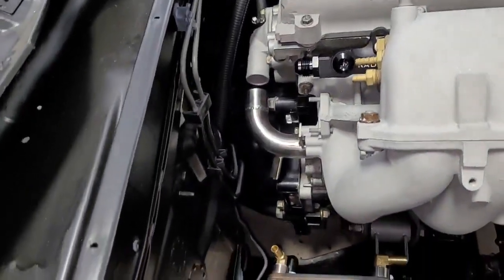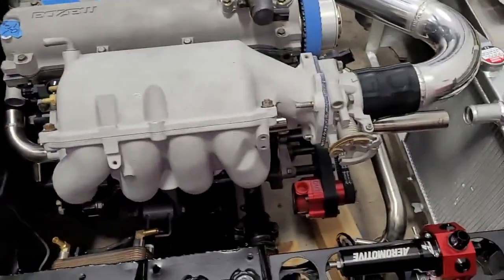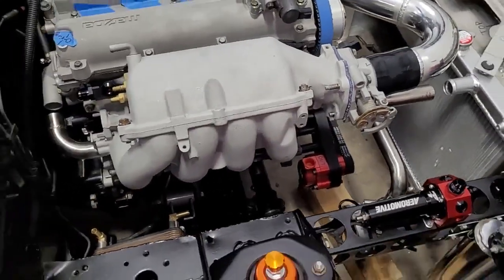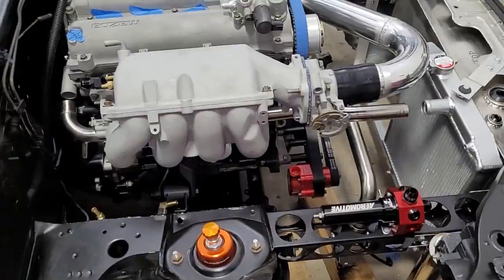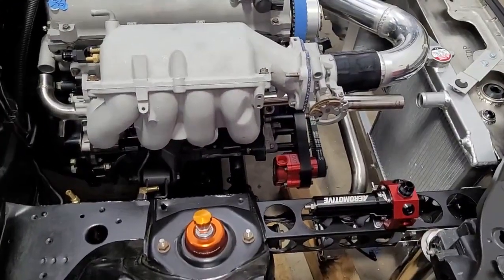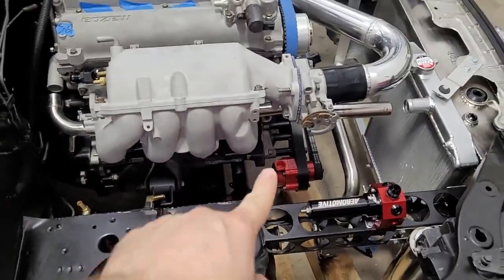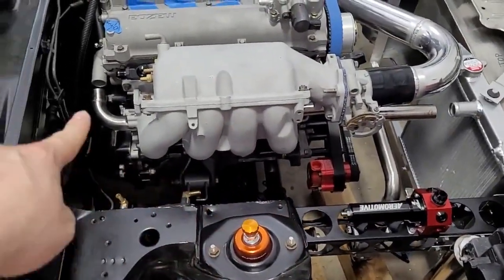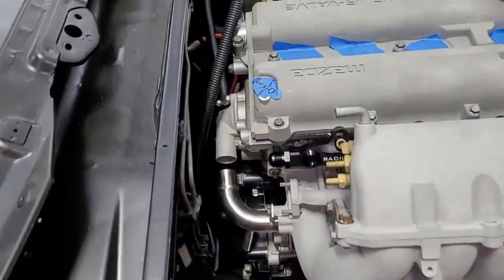So it'll be 2 more hoses. That kind of sucks, but it seems unavoidable. The alternative is almost worse. Like say you try to rigid mount a filter, that could vibrate and crack. That's not a good idea. So the plan will be: fuel comes out of the pump, goes through the filter, loops up and goes into the fuel rail from the rear.